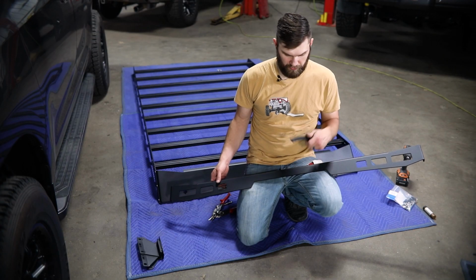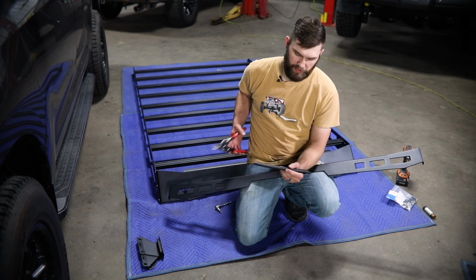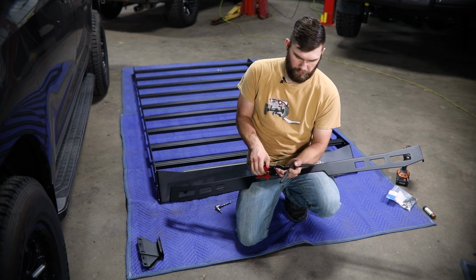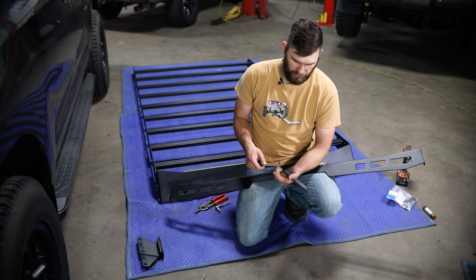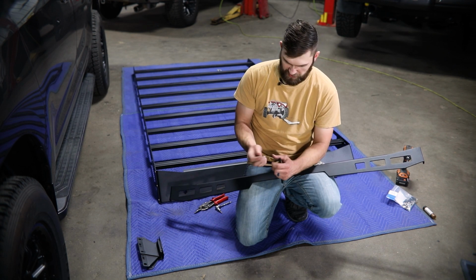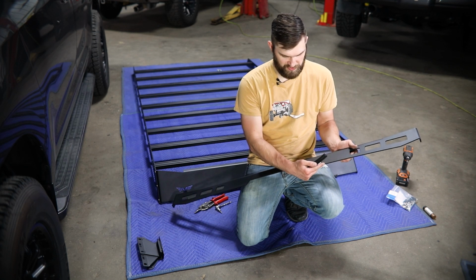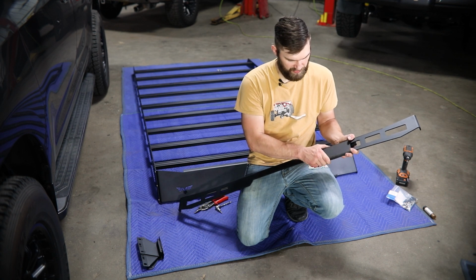Now for the rear fairing, you're going to need to put some edge trim on this as well. So grab the leftover piece you have from the front and you'll simply cut it roughly in half. Again, paying attention to these little aluminum pieces and pulling them out if necessary. And then once you have 2 equal length pieces, working right here on the inside edges of this, simply starting at this point, you can push your edge trim up on each side.